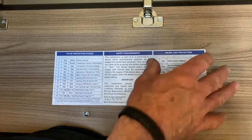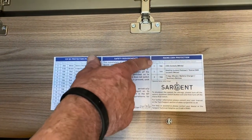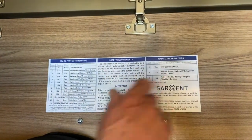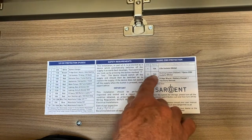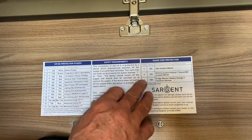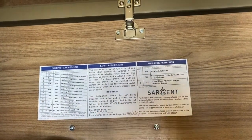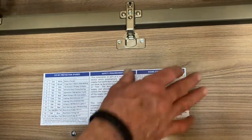We've got a nice diagram here. This is the mains side of things, and that is the 12 volt side. On the MCBs: item one is a 10 amp supply and it serves the sockets within this vehicle; MCB two is a 16 amp supply serving the heating system and sockets; and MCB three is a 10 amp supply serving the refrigerator and other auxiliary devices. That's a quick explanation of how it distributes from these MCBs.